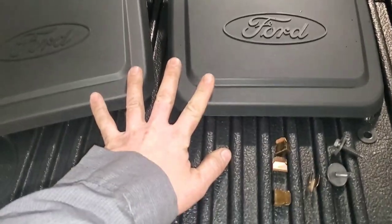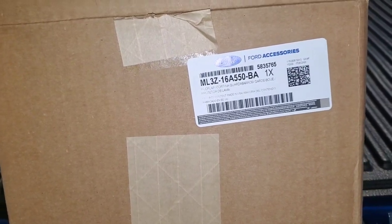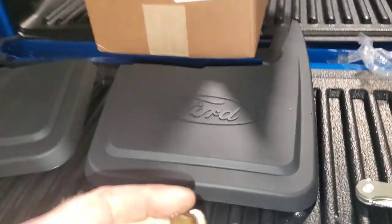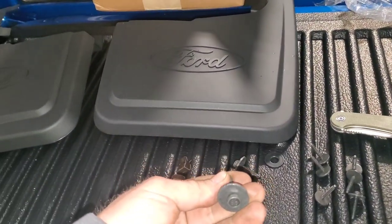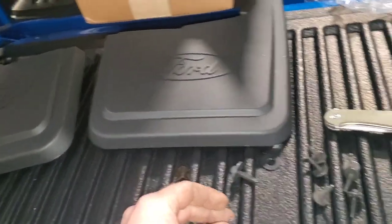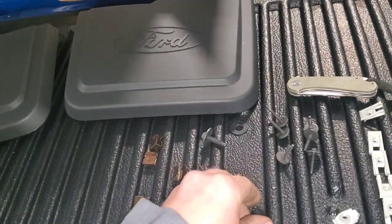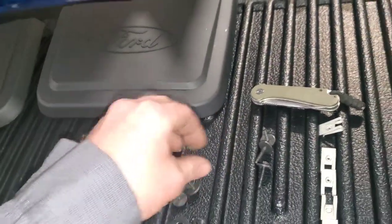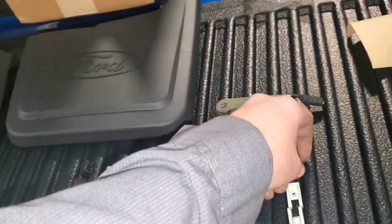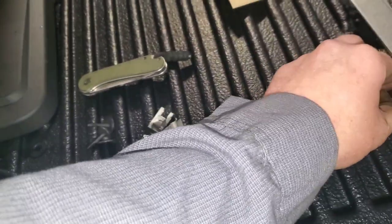Here are the rears. The kit from Ford is ML3Z-16A-550-BA. These clips here go over your foldable flaps that will fold over the body so you're not cutting into the paint. These 10 millimeter bolts will bolt onto this bracket right here. These push clips will go into an inconspicuous spot — I'll show you when we get there. These three will go on one side and these three will go on another, with two clips for one side and two clips for the other.